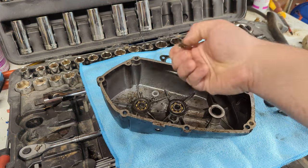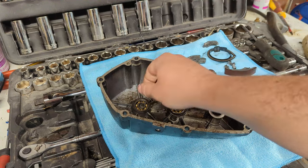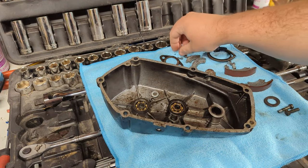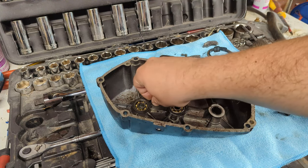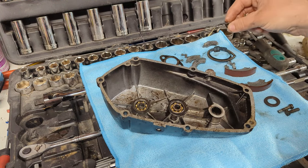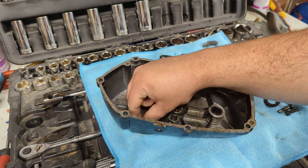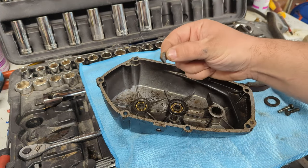And see what state that clutch is in. As long as it's physically complete, we might take a look at relining it, because it's only cork lining and it's only glued on, and I'm sure we can manage to glue cork to some metal if we need to. And while we're there, we'll do some performance modifications, hopefully.